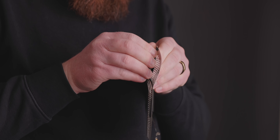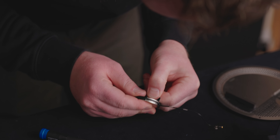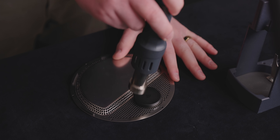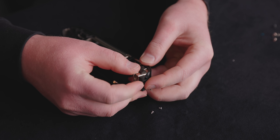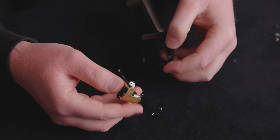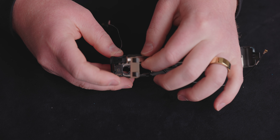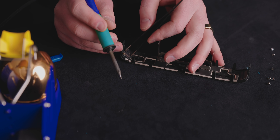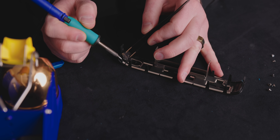Now as for the antennas, these are all wired, so there's no reason why we shouldn't be able to harvest and relocate them. First, we less than gracefully remove the bottom antenna — there is a screw hidden behind a plastic shield that's applied with adhesive, so get that adhesive good and melted. As for the other two antennas, they're both just held in with a few screws, so removing them from the rear I/O shield is very easy. That does require us to also remove the power button, which is unfortunately plastic-welded into place, but using a soldering iron to melt the plastic and remove the board is not too tricky. We're going to relocate all of these components later, which basically just leaves us with this super-wide plastic I/O shield that we can now ditch — it serves no purpose.